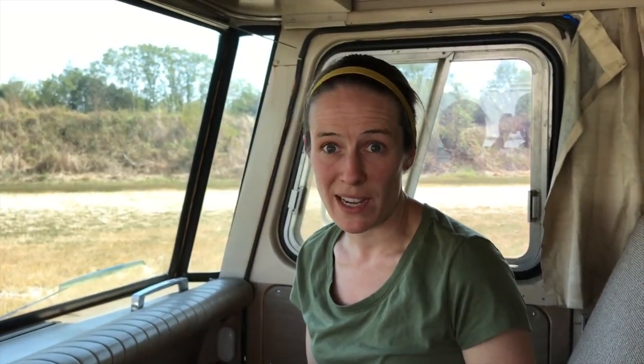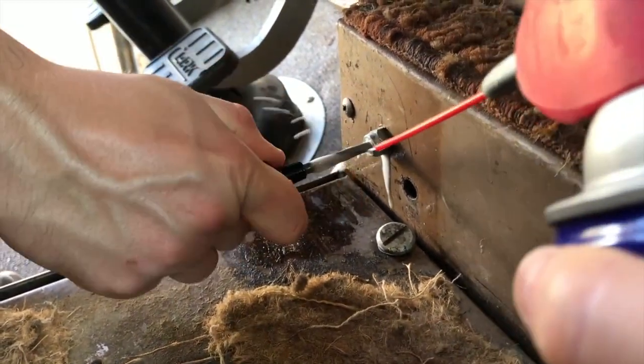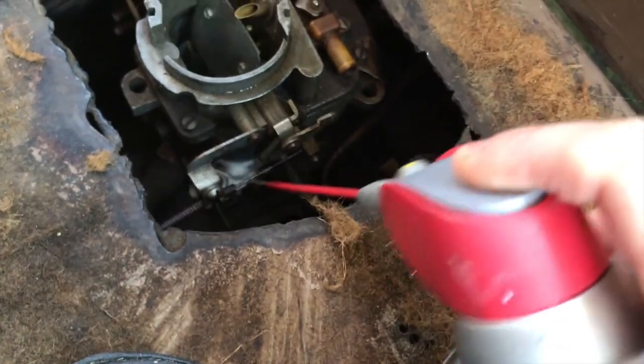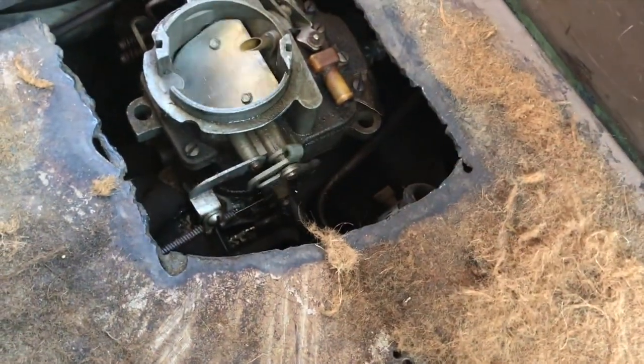Now that we've figured out the choke, we are ditching the starter fluid and instead turning to WD-40. Our choke mechanism has seized, and that's where we decided to use WD-40 to just loosen it. So we'll show you where we've been spraying it — I'm going to spray the choke mechanism with WD-40. What are you doing Andrew? I'm opening and closing the choke valve. And while I'm doing that, you're going to spray the other end of the choke cable — and that is getting our choke mechanism nice and free moving.